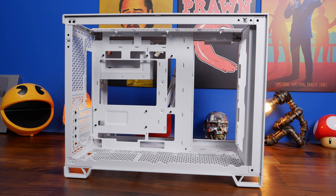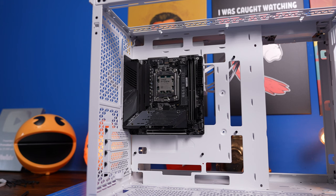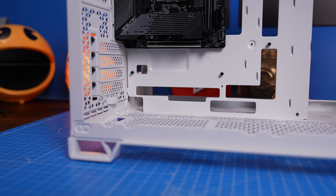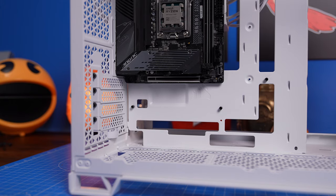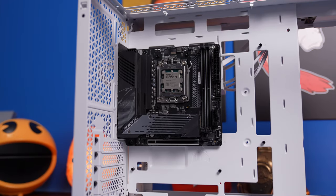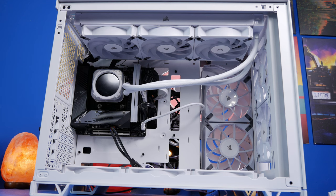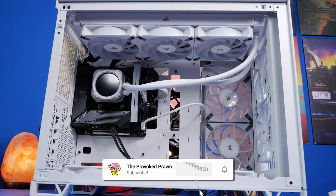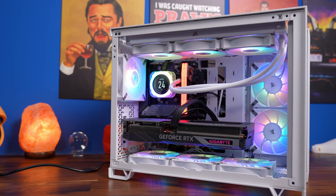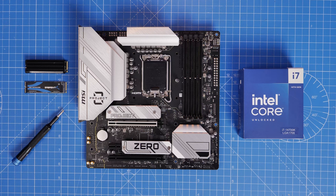You need to be aware of the motherboard compatibility logic. This case works with mini-ITX and micro-ATX motherboards. The mini-ITX version is small and compact, but it sits quite small on the motherboard tray and can be problematic because there are a lot of different spaces for running cables through. This variation isn't the most logical choice as it's generally designed for small form factor cases, and cables can end up looking a bit messy. You get a better experience with a micro-ATX motherboard like the rear-connect MSI Project Zero.